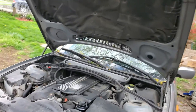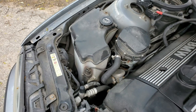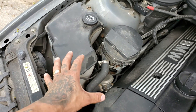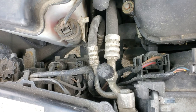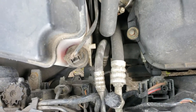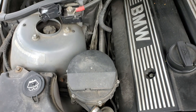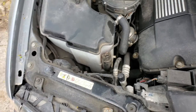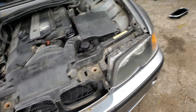There's just a few things I want to do today. I have to take this windshield washer reservoir and relocate it, because where the reservoir is and where the secondary air pump is is exactly where the turbocharger is going to sit. I also have to deal with the AC lines — where those lines run is directly where the manifold will go and where the turbocharger will sit. We're gonna have to fab something up later on down the road to make that all fit.